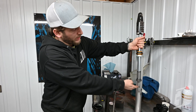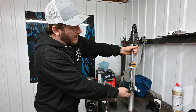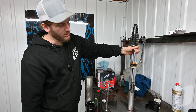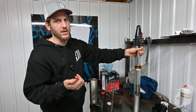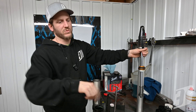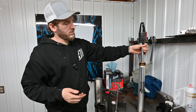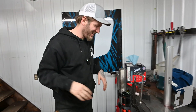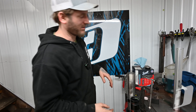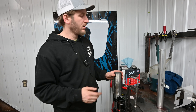If the shock has sagged down so only a small amount of shaft is showing, every inch the piston moves up gets you into the bump zone — and it's going to ride rough. So when you own this type of side-by-side with internal bypass shocks, ride height is way more critical to ride comfort than with regular shocks where it's only the piston valving. My tip: if you've got these fancy electronic shocks with the live valve, worry about your ride height more than anything else. If you have any questions, leave a comment below. Hope you found this informative — we're going to get back to work on these shocks for Bill. Thanks for watching.